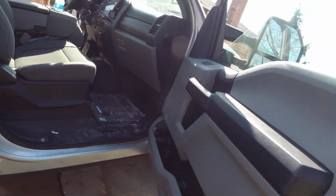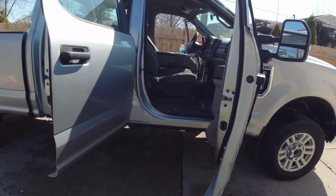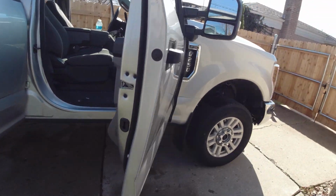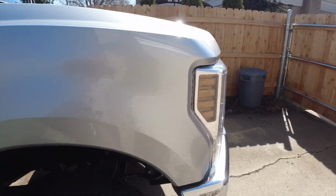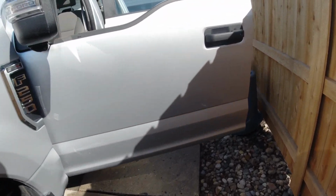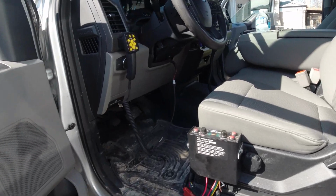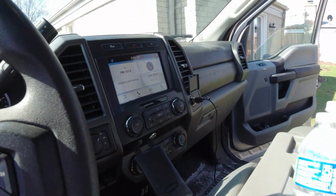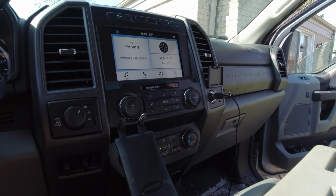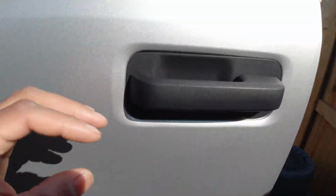because it definitely seems to be moisture related. It was working the other day, but we got rain last night, so I'm wondering if moisture is getting in the truck and if it's getting on the actual wire harness, because it literally was working intermittently yesterday, but now today there's absolutely no radio functionality at all. Like I said, the radio actually is working. Everything works, the Bluetooth works, but there's just no connection between the radio and the speakers. So I don't know if there's an amplifier somewhere.